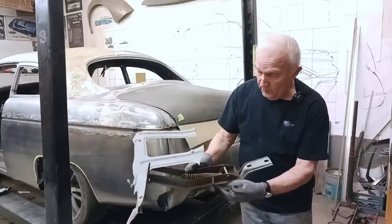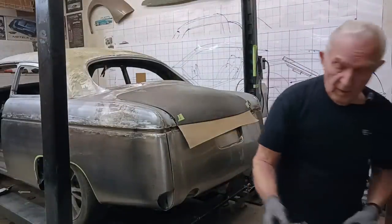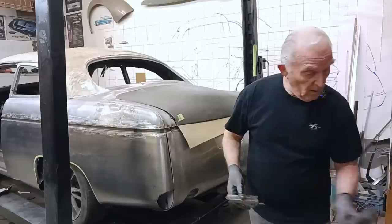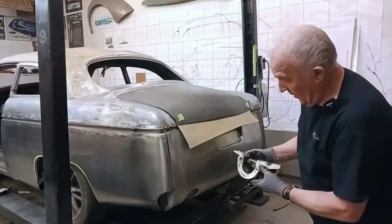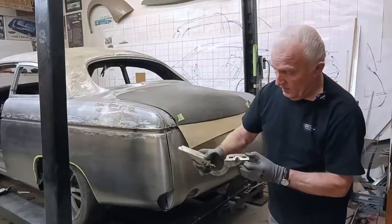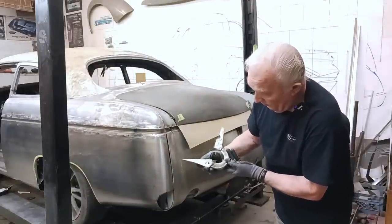We have to replace this conglomeration. What we did was take some box tubing and made up channels to mimic what was underneath there, except no spring — just a pivot pin. And there it is. That's your pivot, and it will work in there like that. It'll go underneath the rear deck. The mounting surface is basically the same except that we lowered it, and it makes for a quite neat-looking hinge. It will function identically.